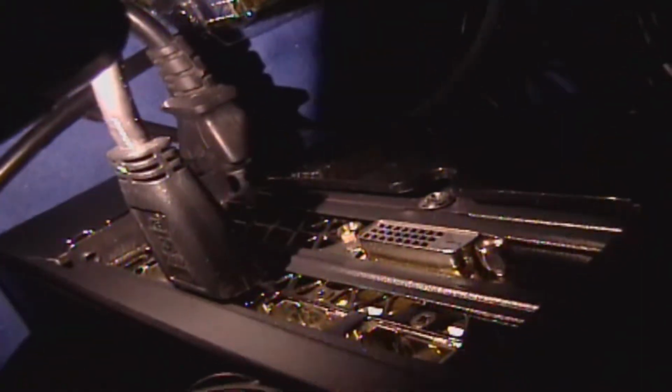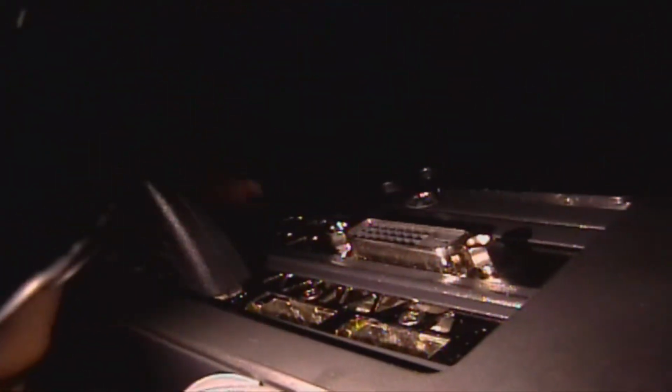And here I'm just showing you that I'm not lying to you, and I actually have the onboard graphics plugged in, and I have the GPU plugged in, both separately. So, got the flashlight here. I'm gonna show you real quick. I'm dubbing this. And as you can see, my HDMI is plugged in. There is no analog signal. These are all HDMI ports with one DVI-D, but this DVI-D does not give out an analog signal. It only gives out digital.